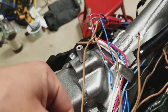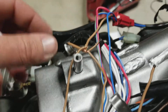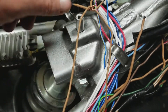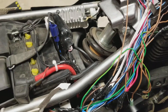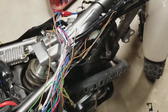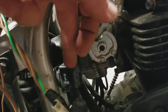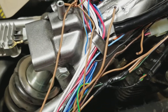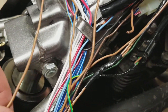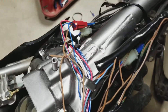Anyway, that leads us to this magical wire. I was hoping that the whole bike was powered off this single wire — because all I had with these two cut, all I had to take care of was the rear running light was on. My flasher was doing something weird because it was getting power backwards since the running lights weren't on. So I knew I needed to just eliminate the flasher relay getting power completely. I was hoping to cut that and eliminate power to the rear half of the system, but it wasn't this one.